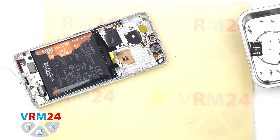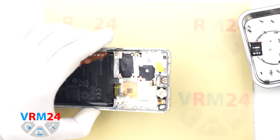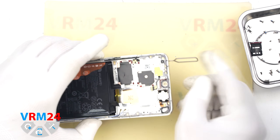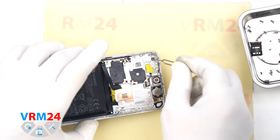The top microphone port is the same story as the bottom one — it is inside the display frame with an L-shaped channel, and the microphone component itself is mounted on the back of the motherboard. So inserting anything into the hole won't damage it.